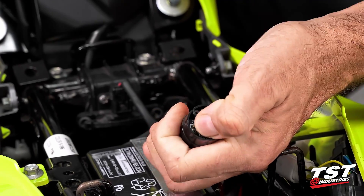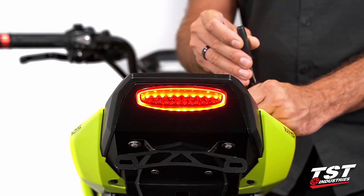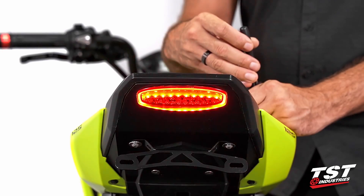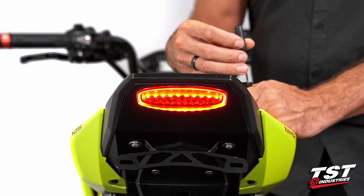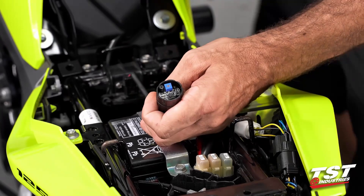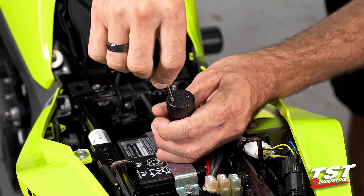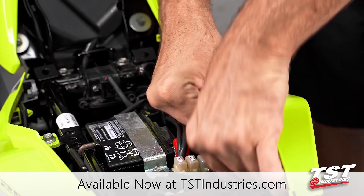If we change to the next one — pulsar — this one just keeps on flashing, and I like to have it going pretty fast, but the choice is up to you. If you want to explore the next mode, we have intermittent pulsar; this one I like somewhere close to the top of the range to make it the most visible, but the decision is ultimately up to you. Once you're done with your adjustments, replace the cap, turn the screws back in, replace your brake light modulator in the space you decided, and you're good to go.